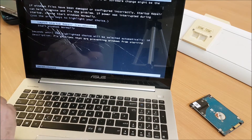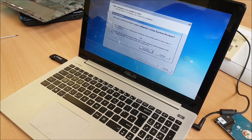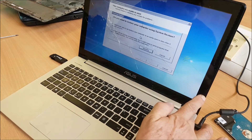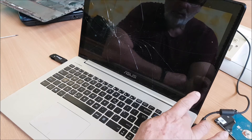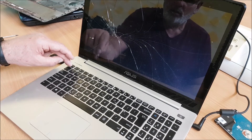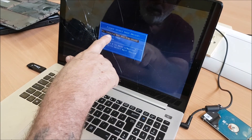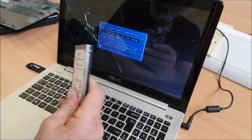If it's all okay I'll do a video on replacing the screen as well. So I've put in a USB stick containing Windows 10 64-bit. I'll hold the power button down for about seven seconds to make sure the machine is totally switched off. On these you press the Escape key to get to your boot options. So I'm pressing Escape and — with a bit of luck — here we go. It looks like it has found the drive. Before it wouldn't find that drive, so I presume the drive I took out is absolutely knackered. It's a 500 gig but it wouldn't find it.